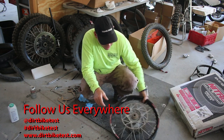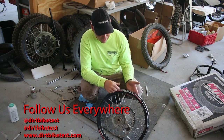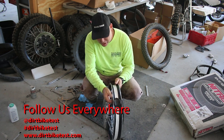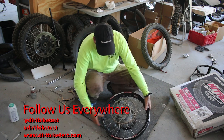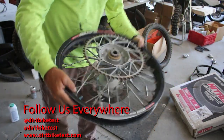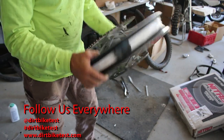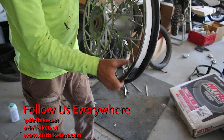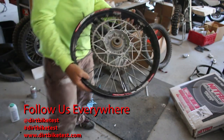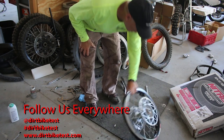Here's my rim — this is an unprepped rim as far as mooses go. It's the first time it's had a moose on it; it still has tubeless logos because I took a tubeless off to put the moose in. I'm running a rim lock — I think a 2.15 rim lock. I also have a valve stem painted a different color so people know not to try to air it up, but it's there to pop the bead if needed. The rim doesn't have any lube on it yet.